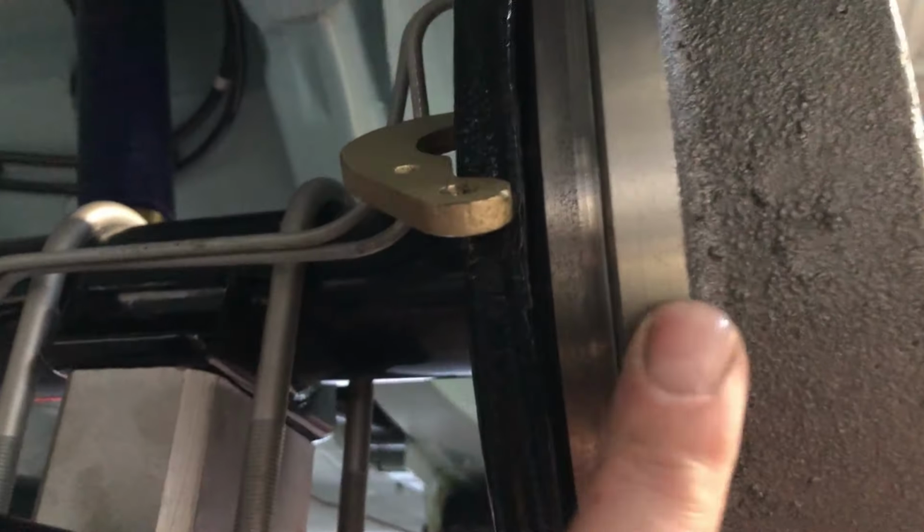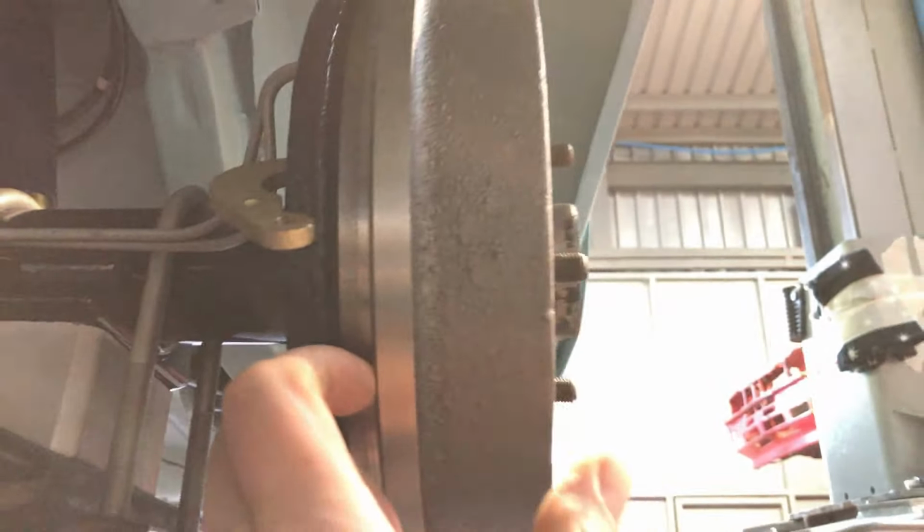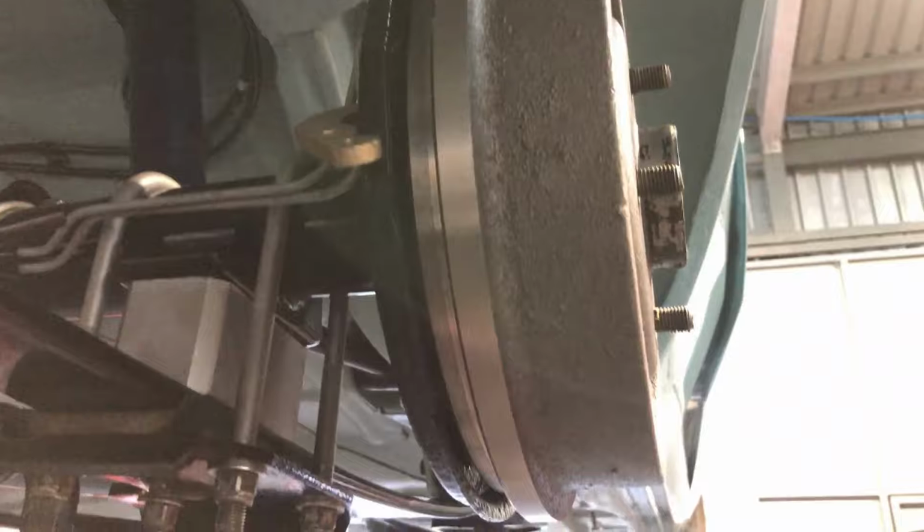And that's because these are RS2000, all the brakes are RS2000, but the back plates are Capri and the spacing is slightly different. The Capri has a much deeper rear drum and bigger shoes, hence why things aren't lining up, not working. So I'm going to get them swapped.